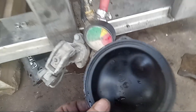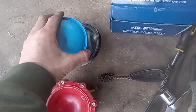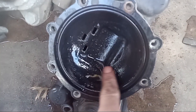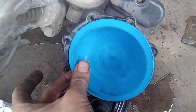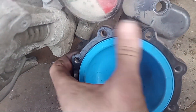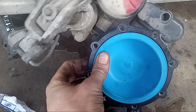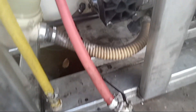Under the cover we have our air accumulator diaphragm. Size them up together — flip it upside down and make sure it's the same size. Sometimes there's a lot of junk in here, so take a rag and clean it all out. Then this just pops back in. You'll see a little track — that's where the groove rests. Seat it down in that track nice and firmly; it just seats down in there. Put the cover back on.